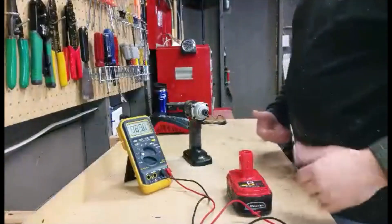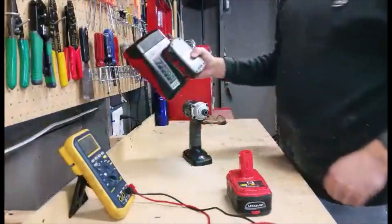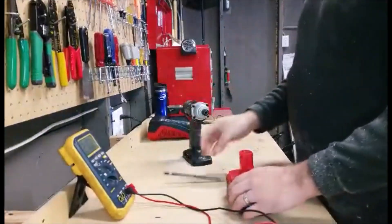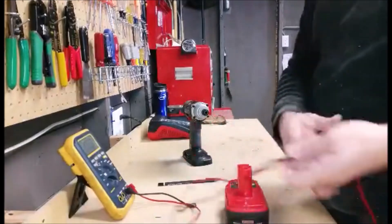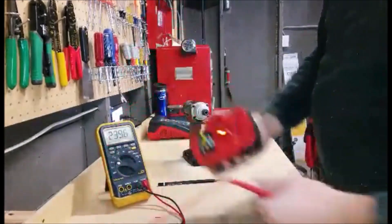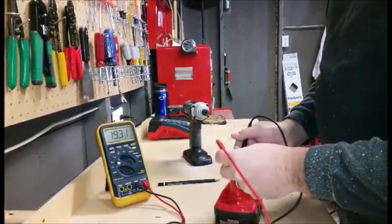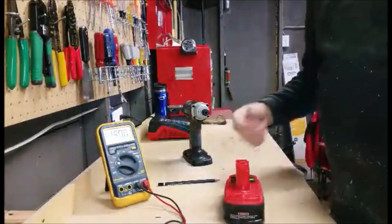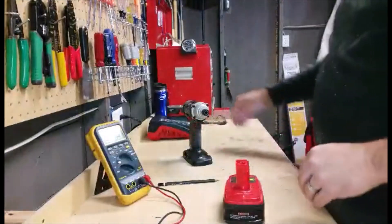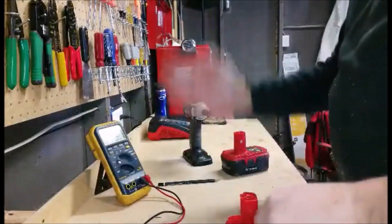It's been about an hour. We put the battery in the charger after I woke up the lithium-ion cell, and it's still sitting there — it's fully charged at one hour, which is usually what they take. For a voltage comparison, my other lithium-ion battery was already partially discharged. The little indicator on it is giving the orange light, meaning it's at medium — about 19.3 volts. With lithium ions, they're supposed to maintain voltage throughout the entire discharge cycle, as opposed to NiCad and similar. That's what makes lithium ion so much better — it just goes and then stops.